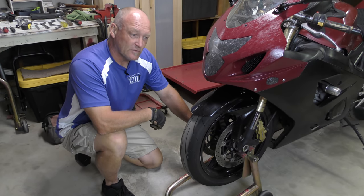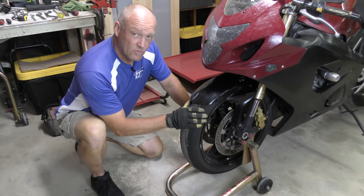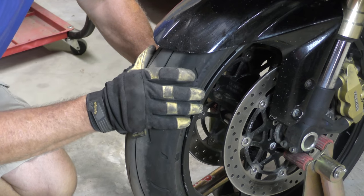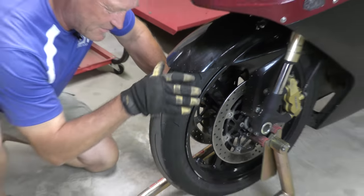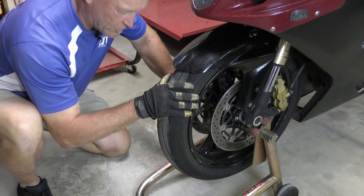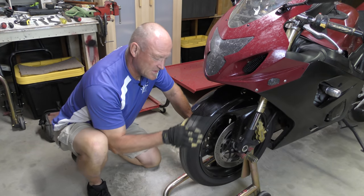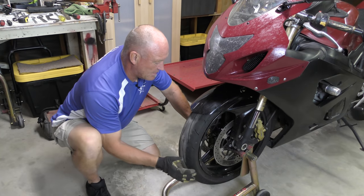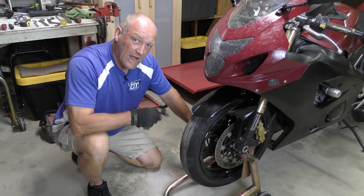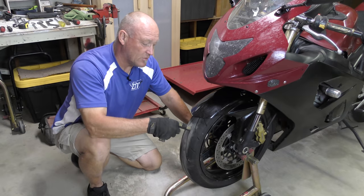It is unique to each set of wheels, even though all the rotors were cleaned and put back to original surface. We have some issues. With our Q3s, it goes off, same, same, looser, right there, and then a brick wall. But then if we go back to where we were, that one spot is relatively speaking freer, and then everything back to where we were is a little freer. So something's going on with either the rotor or the brake caliper pistons, or both, that is creating an enormous amount of brake drag. This is only unique to our Q3 wheel.